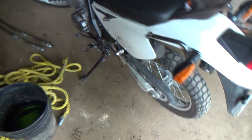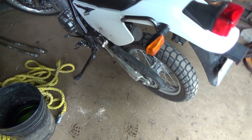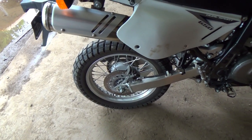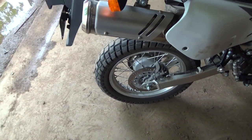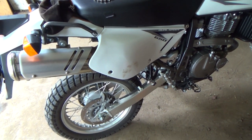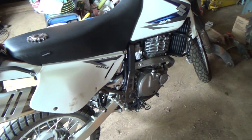So let's get her in position and get some tools. We got to loosen the tension on the back axle here, and then relieve our tensions, and then that'll let the wheel up as tight as it'll go after we loosen these little bolts. And then we can get that sprocket loosened and hopefully pulled off, and all should be good. Then we can start putting her back together.